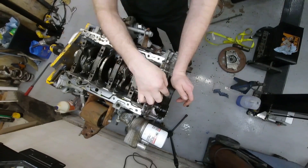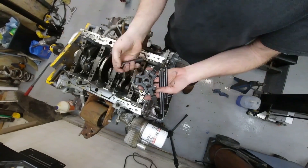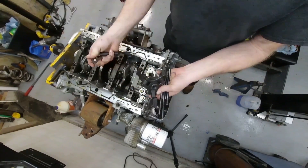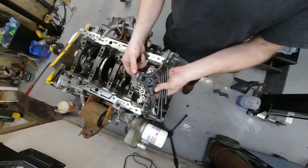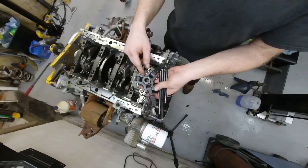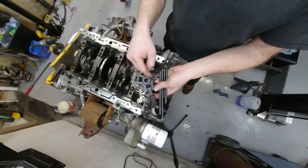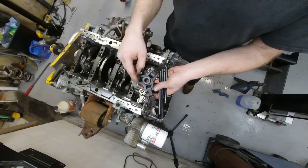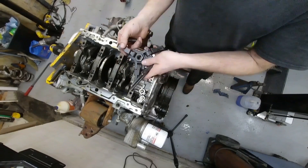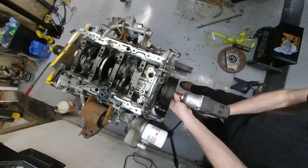I'm going to go ahead and get this thing off. If this is going to require a special puller, it looks just like this guy here. It comes with different length pieces — this one obviously to go in there. This puller design was originally designed mostly for Chrysler vehicles, and it seems that all the manufacturers now are really starting to integrate this style of puller for the balancer versus the bolted style. This one's got the spots for hooking these very heavy-duty hooks onto. I'll go ahead and throw a link in the description for one of these.